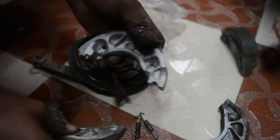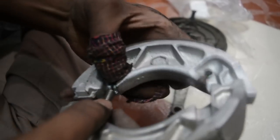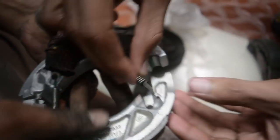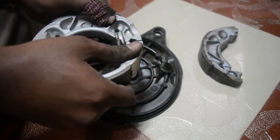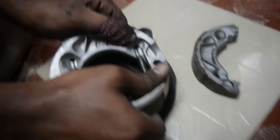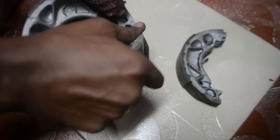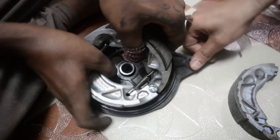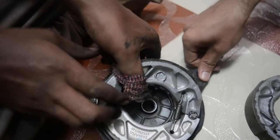The next thing you have got to do is put the springs back in the orientation you found them in. Use a pair of pliers if you have one, or you can actually do it by hand. The stronger spring goes on the pivoting side, and the spring with lesser stiffness goes on the cam side — the cam side is the side which actually actuates, moves, and expands the shoes.